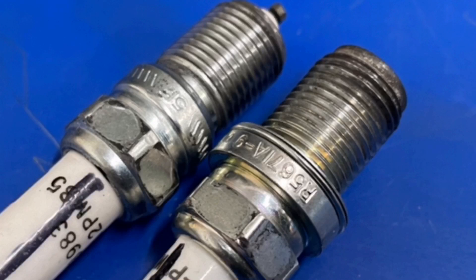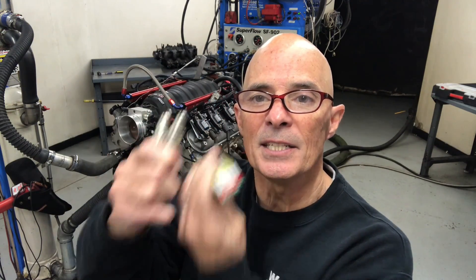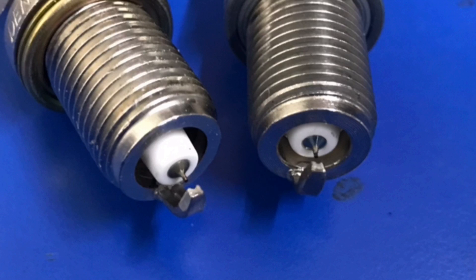What if I test gasketed plugs versus tapered seat plugs? Well, the LS cylinder head will accept both of those and I interchange them all the time. The question is, I've never tested them — so is there any difference? What we'll do now is install our IK-16s, take these plugs out, install these, see how they do, and then compare them. This is the hotter heat range, and then we'll compare them to the IK-31, which is a colder heat range. Let's do the swap.